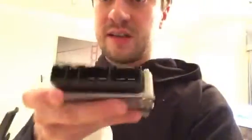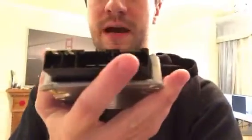So what you'll find, if you look at this, is the guy over here is where the power comes in. This one here is where the motor goes out. And notice how many wires it has. It has 2. So it looks like Toyota's using just a brushed motor, which is a little sketchy. The reason a brushed motor is a little sketchy is because if you have FET latch up, that's going to apply full torque to the motor, which isn't great, especially also this thing, oh, it does have a relay. Okay, all right, so it does have a lockout relay here. You can see this relay, I think that is locking out the FETs to prevent FET latch up, so that's a good thing. So there's a bit of safety in here, which is good, but brushless motors are inherently more safe than brushed motors because if you get FET latch up, you get weird behavior, but you're not going to get slamming the steering wheel to the left or to the right.